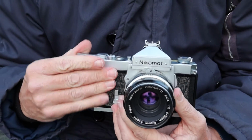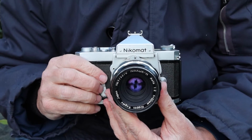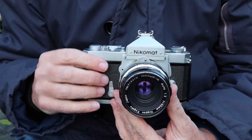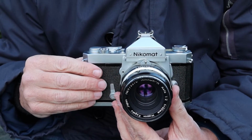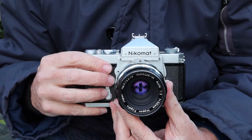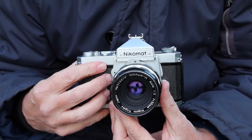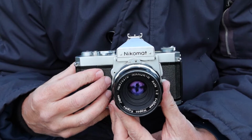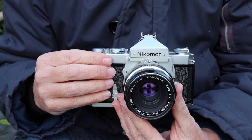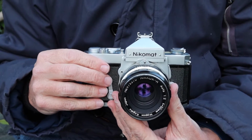This camera has an unusual shutter compared to some of the other older cameras, the professional F series, which used a horizontal titanium shutter. This camera features a vertical shutter, which is for a lot of people a more accurate system or a more reliable system. Nikon eventually moved to vertical shutters in their later cameras, and this allowed for things like higher flash sync speed. It's an interesting system, and it's kind of a good system because there's less motion in the camera.